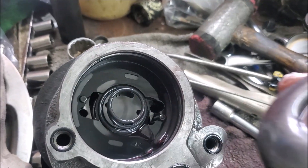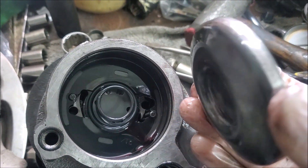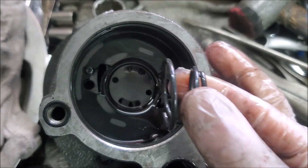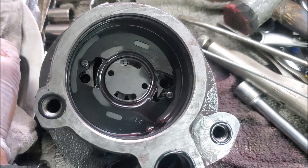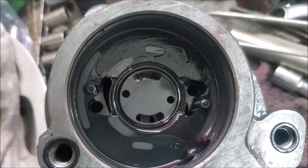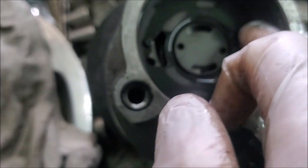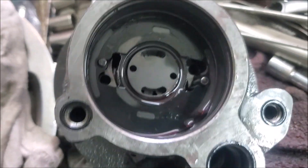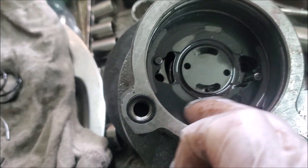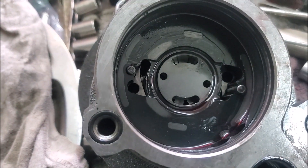I started taking that ring off — I clamped the thing to stop it coming out. It actually wasn't that bad; it didn't fly out. Next thing is the ring spring — that small spring — so it's not that big. Now you definitely want to be careful about how this comes apart because it has to go back together. There's a particular piece in there that needs to go in a particular order: it looks symmetrical but it isn't. I'm going to make notes here.